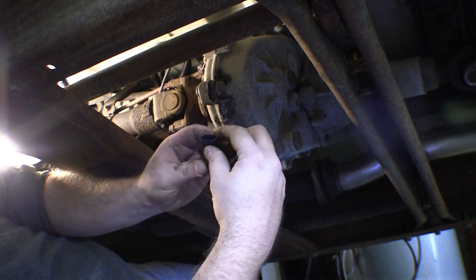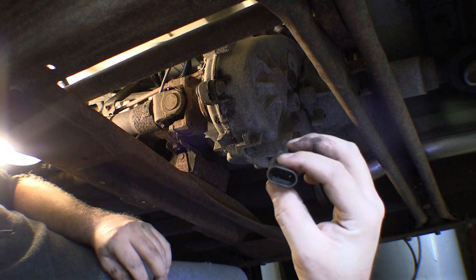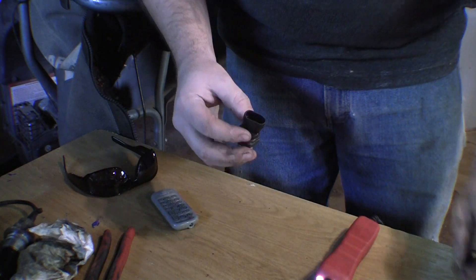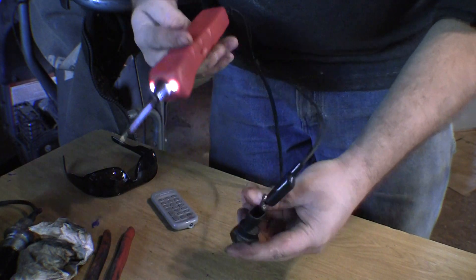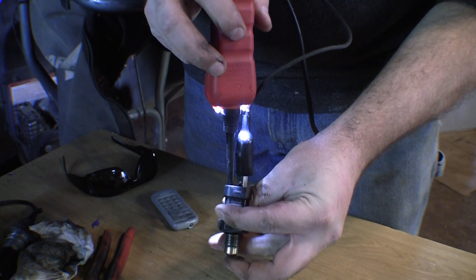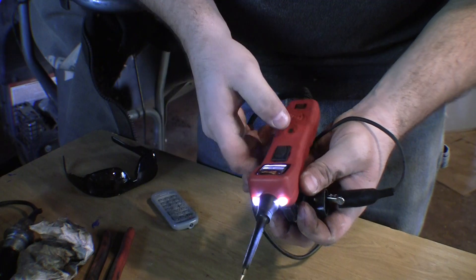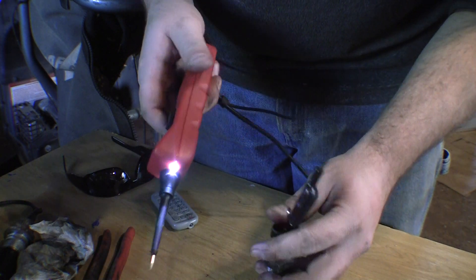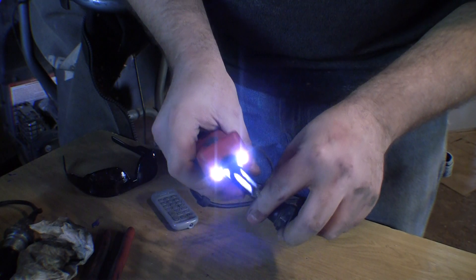Yep — that is the pin for the blue wire. It's possible I could just straighten that pin and have a working switch again, that'd be great. Continuity test: I get the clip on the far side pin, actuate the ball — I should have continuity on the other pin. I wasn't in continuity mode before. Ball actuated — yes, continuity confirmed. That was definitely my fault.